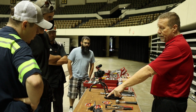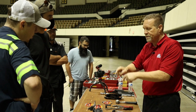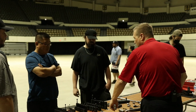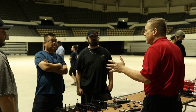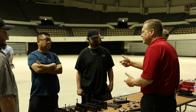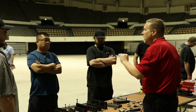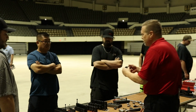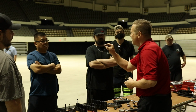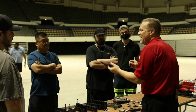Because ours is bidirectional and it bites in 6 different spots cleanly the same way, and the pressure's constant all the way through the torque curve, it doesn't let go, it doesn't chew once it's banged down on there. If you go to my YouTube channel, Dan the RBRT guy, I've got a video of me in a wheel where I rounded lug nuts, both the aluminum capped ones and a hollow one. The aluminum capped ones, the pusher just pushes it right out, no problem. The hollow one though, the pusher will go through the middle. You just screw it onto the stud and let the stud be the pusher, the resistance, and it pops it right back out.